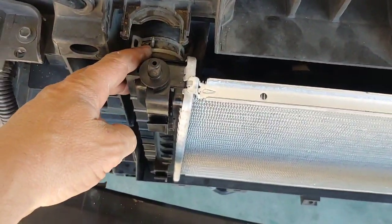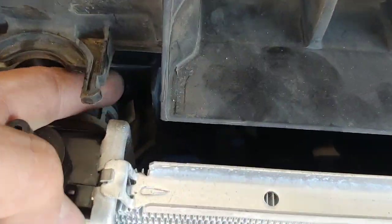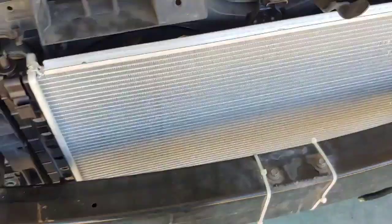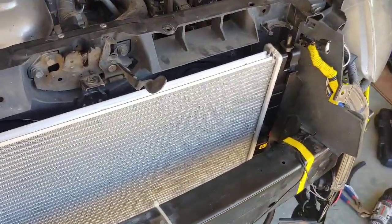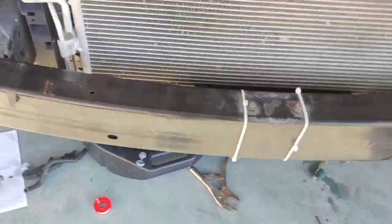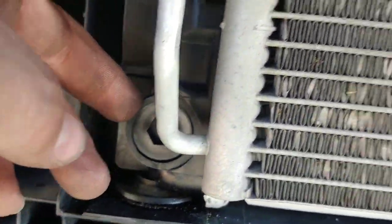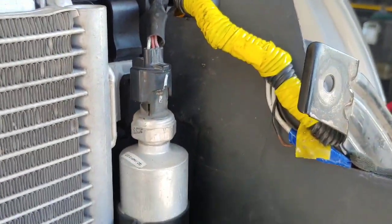Upper radiator hose is on. Make sure the clamp is facing up — if it's facing the other way you're gonna hit right there and won't be able to get the radiator to fall all the way into place. Put the rubber grommets back on top and snap it back into place. Then do the condenser — mount the condenser and start connecting the hoses back. The condenser's back in and just falls right into those little clips. Plug back in your high-pressure switch.